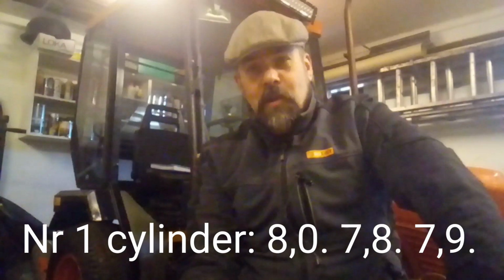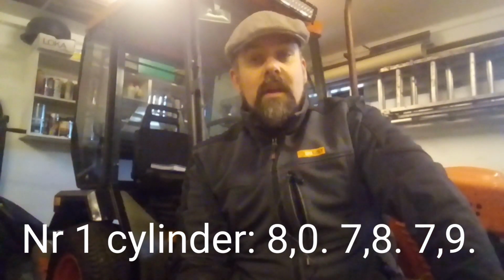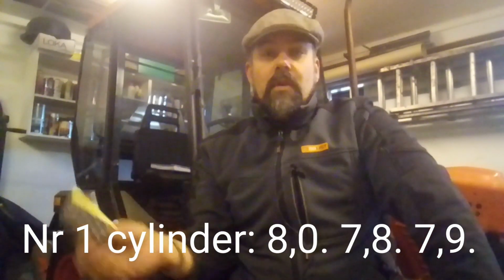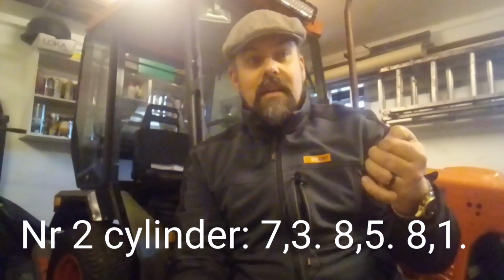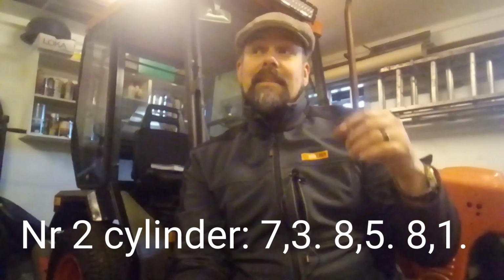I had to go in now, it was so cold outside. I have now done 3 tests on all 4 cylinders to see the compressions, and I am none the wiser. It looks like there's no real problem with compressions. The first test I did from a cold engine, because I cannot start this engine and let it idle until it gets hot, because of the bad sounds. I'm afraid I will break it more, so I did it from a cold engine, and that is wrong, I know.